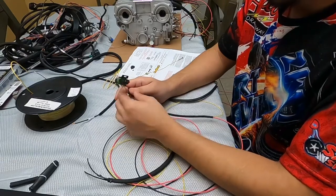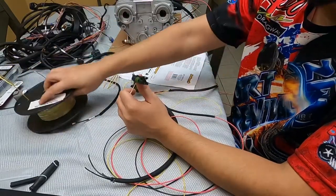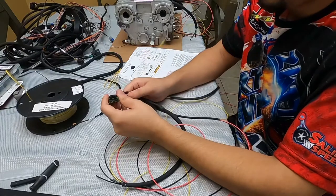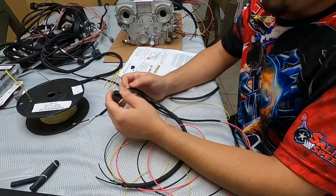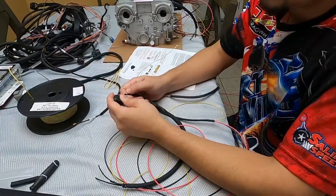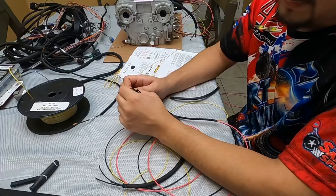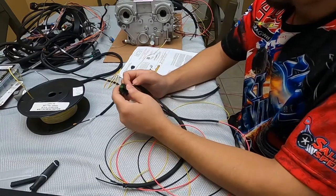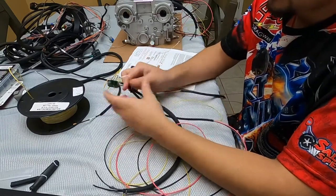This 20 gauge feels a little too small, a little rinky-dink, so I'm going to take it off and change it out with 16 gauge. The rest of the wires — all the grounds, the ignition power wire, and the signal wire — are also going to be 16 gauge. That was recommended to me by Halltech themselves. They said if you can run 16 gauge, run 16 gauge; if not, run 18 gauge. I'm going to run 16 gauge to be on the safer side, once the connectors come in.